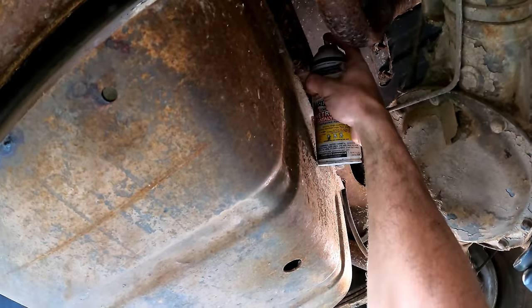Instead of having the Exxon Valdez in my backyard, that tank could crack at any moment with all the rust. I've got this diaphragm pump — it's pretty awesome for pumping gasoline. It operates off of air pressure and has two diaphragms. I'll drop the hose in through that convenient torn hole in the top of the tank. Check out how fast this pump is — look at that stuff coming out! It can barely pump it — oh, I kinked it. Now we've got full prime.